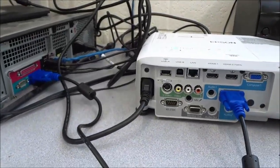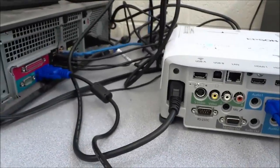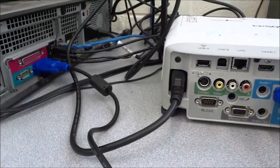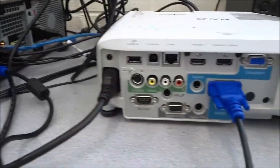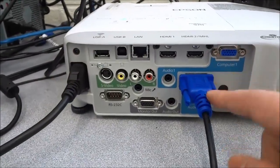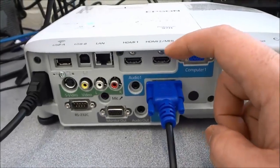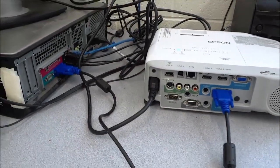And that is basically it. In this video I have shown you how to connect a projector to a desktop computer. The only things that you have to worry about are two cords. The first is the power cord, which simply connects the projector to an electrical outlet. And the second is the video cord, which can come in a few different forms, but for this video I have used the VGA video cable to connect the projector to the computer. And that's all I have for you today. Thanks for watching.